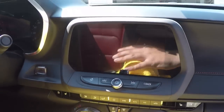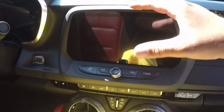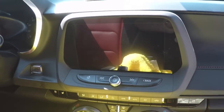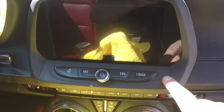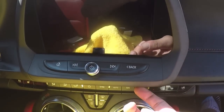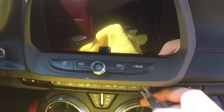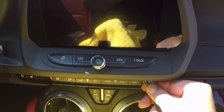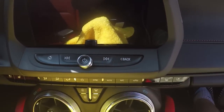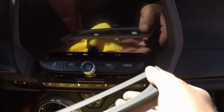I would recommend using a towel or microfiber to put over your shifter, because we're gonna have to pull out the radio and just want to set it down over here — you don't want to scratch your screen, so just a little added protection. Now the first part of getting this radio out: take this little plastic piece that goes around your buttons and stick your interior tool underneath where you can feel the seam, get it in there, and just wiggle it — it pops out pretty easily.